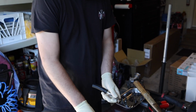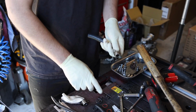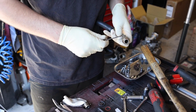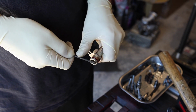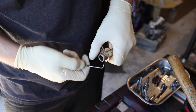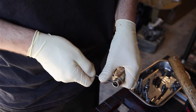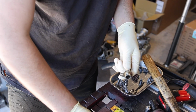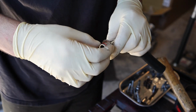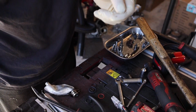Next, we're going to take some of our lines, the coolant lines, return lines. We're going to take these O-rings off and just replace them with the supplied ones by EQT. Definitely replace these. They give them to you. There's no point to not use them, even if they inspect good. Just replace them. You don't want to do these again. Clean up the groove a little bit. Let's put the new one in. Boom, just like that. Got that one.